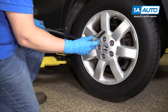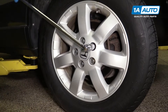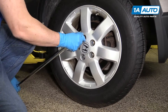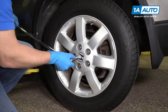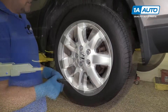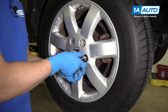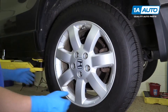I'm going to take this wheel off. We're going to use a 19-millimeter socket and a breaker bar, loosen up the lug nuts just one at a time before we put the wheel up in the air. Now we'll raise and support the vehicle. Now we're going to take the lug nuts off — just use the socket to help us. We'll take the tire off.